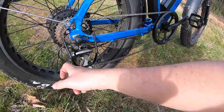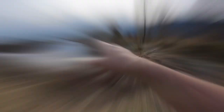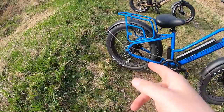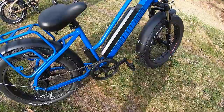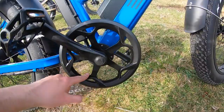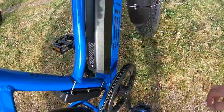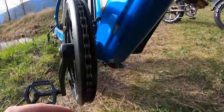We came from a trail over there where the branches were coming at you from both sides, so it was really nice to have that derailleur guard. One last thing on the electric system: right here you have the magnet disc for the pedal assist system — a 12-magnet disc that counts the rotations of the crank as the bike moves and doles out pedal assist accordingly. It's a tried and true system that's been around for a while.